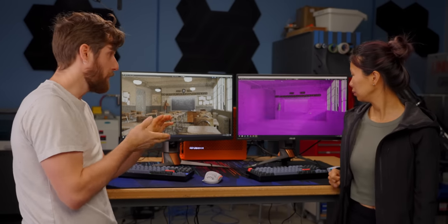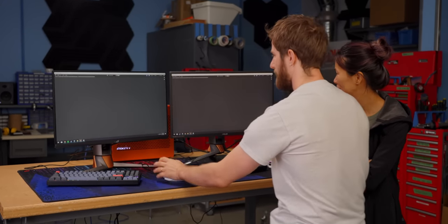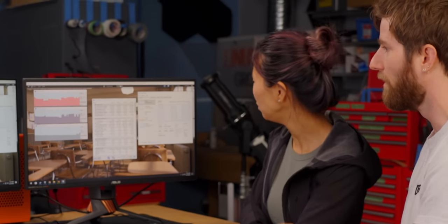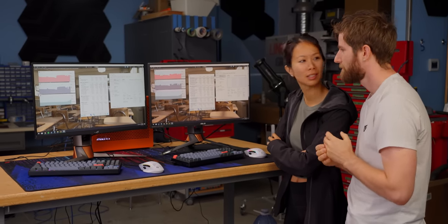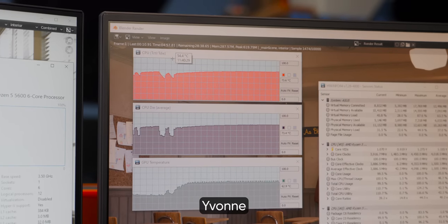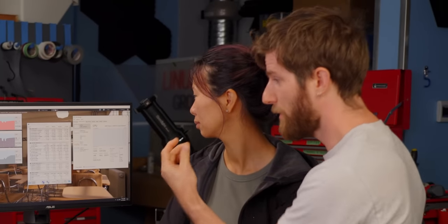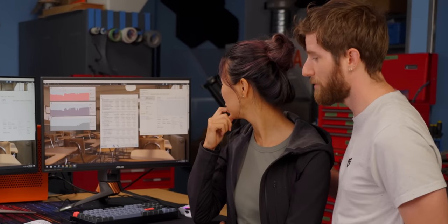I've got Blender set to use both CPU and GPU. Here we go — and they're off. CPU's at 100, GPU's at about 90. This should give us a pretty good idea of what the system will look like under full synthetic load. Realistically in game, are you actually going to get to full load like this? No — but you want to make sure it is prepared for the worst case scenario. My CPU is running a lot lower than yours: 75 to 68. It's also not turboing as high still, which is weird. You may have just gotten a not-as-good chip. You did end up with the beta system after all our efforts — sorry, entirely unintentional.